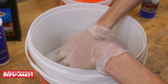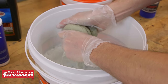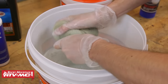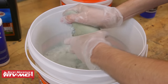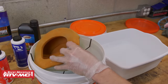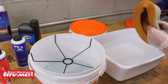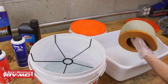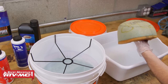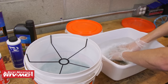After it's sat in the solvent for a couple minutes, I'm going to wash it out and squeeze it a little bit. You never want to twist and wring out a foam filter — it can damage the foam. I'm going to rinse this until it looks clean. After cleaning it in the filter cleaner, you need to rinse it out. If you use kerosene or an automotive solvent, you're going to want to wash it with dish soap first to get the solvent out of the filter so it doesn't break down the oil when you go to re-oil it. I'm going to put a little dish soap on this and wash it in warm water.